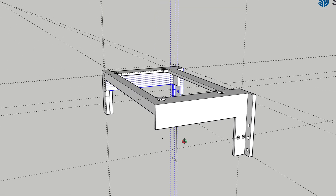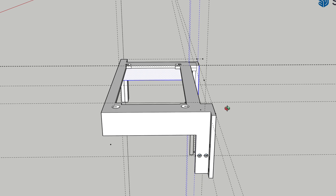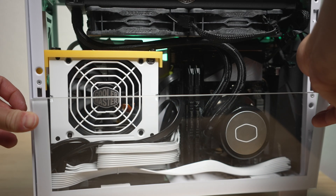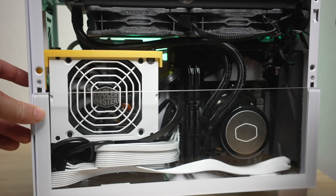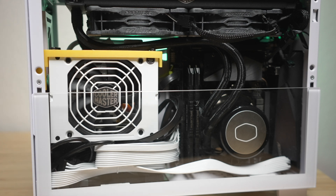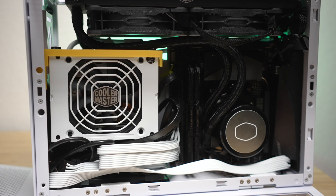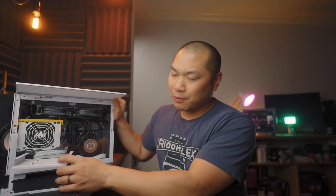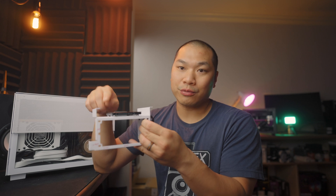This is more of a half cage compared to the original full cage that extends all the way down, but it uses the same holes plus additional ones at the top position for a secure hold. I printed it with holes and tapped them to 6-32. The front ones use a countersunk screw and the back ones use a short 6-32 screw. I also printed an additional set of holes so the unit has the option to move up a little more if you're using thinner fans. With the T30s I had to use the lower position, but with a 25mm fan the upper position would be possible — about a centimeter higher. I was able to inset it so it sits about 15mm in from the side panel, enough to let the fan breathe even with glass on both halves. There's still a space at the back for cables or a 2.5-inch SSD.